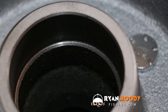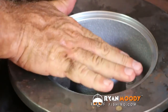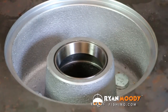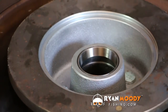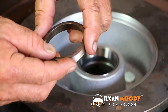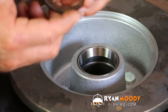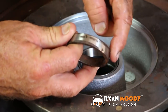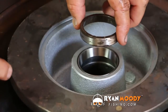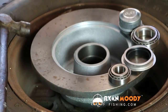That's the hard bit. Now this is where these little tools come in handy. I've got that down nice and flush there at the moment, but I've still got another 10mm to go. So what we do next is grab one of these little tools I've made. It's pretty easy to make. What it is is simply an old insert exactly the same as this. It's got the thick side and then the thin side, it's got the taper on it as usual, like all bearings have. Now what happens is you have to shave this down, probably 1/15th of a millimetre if that, just so that it'll fit inside the actual centre of the hub without having to be forced out. You can actually pull it out with your fingers.